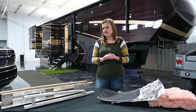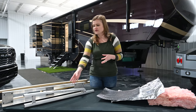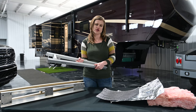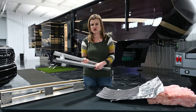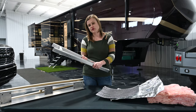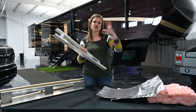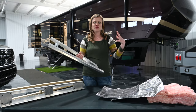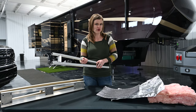We are definitely going to have a little bit different structure involved in what we do, because what we have is a welded construction throughout the entire shell of that coach. We'll use that nice thick gauge aluminum welded so that we would reduce any flex in the coach. That's going to create that super structure working together with that substantial chassis to create the whole of the unit, making sure it's very sturdy going down the road.